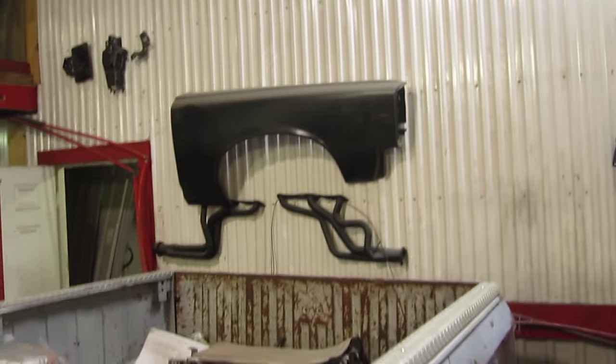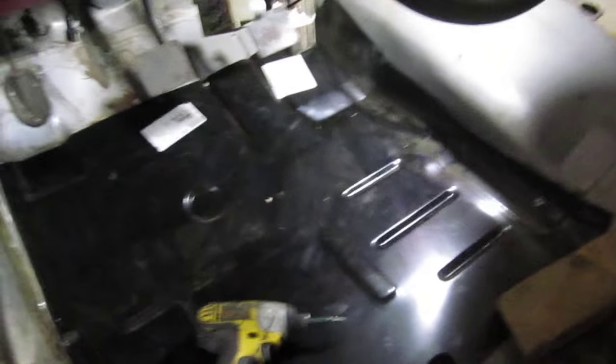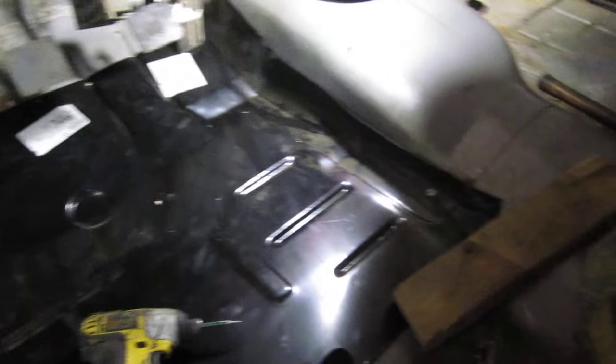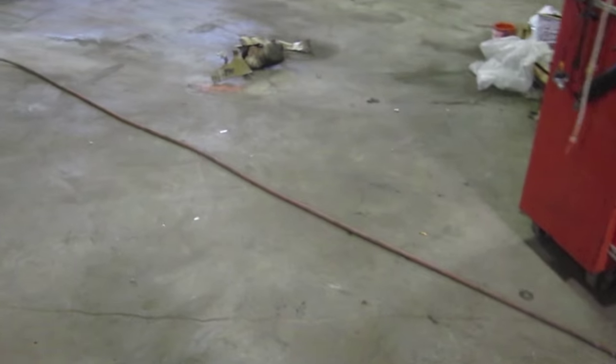That's what you get with aftermarket parts — you have to work with them. With our GTO we couldn't get those aftermarket fenders to fit nice, so we went back to the originals and the gaps were 100% better. Floor panels are generally okay though, so we're gonna screw it down and cut it 100%. Right here is your frame rail, and then it tees off — you'll see all spot welds underneath. On the Dodge there's also an inner rocker which folds over and is all spot welded. By the time you get your floor out it will look like this, and you'll lose a pint or two of sweat. Hopefully we'll have it in by tonight and get the shifters in — then the truck will almost be mobile.